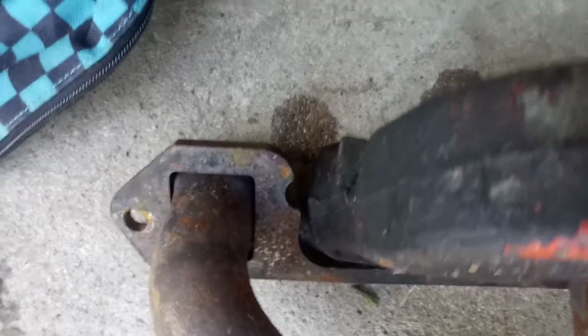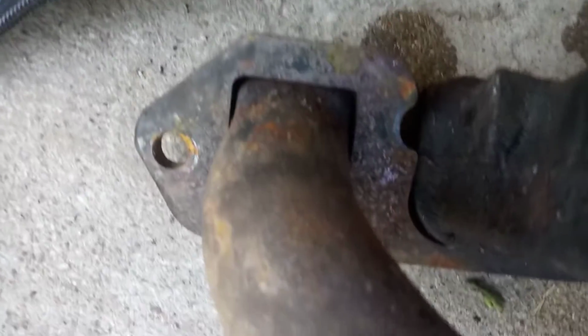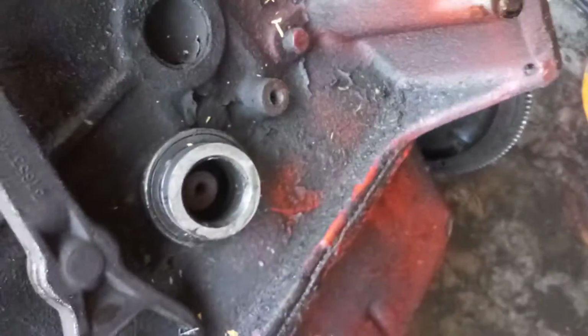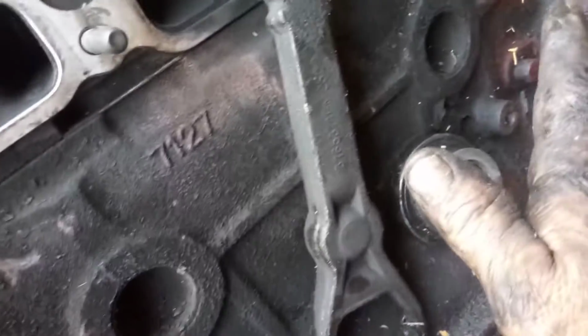See there? When you go to put a header bolt on there, you got to put some really fat washers on there, thick ones. Not just regular washers, some thick washers. And then plus on top of that, you got 2 headers that are going on there. And then you got to account for your clutch, your Z-bar bracket with a pilot bearing on it. You gotta put one screw on there, and then have someone hold the headers up, cock it up at an angle, put the other bolt on there, tighten them up, and then you got your header right. It almost takes 3 people to put the headers on this thing, because you got to hold 3 different parts plus that.